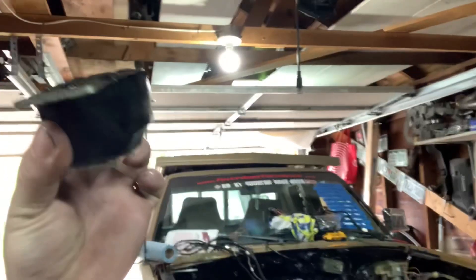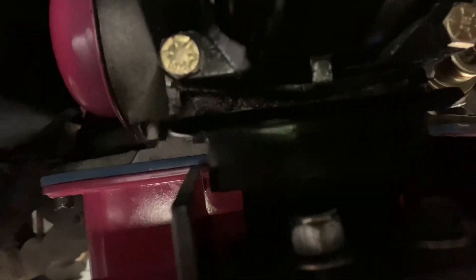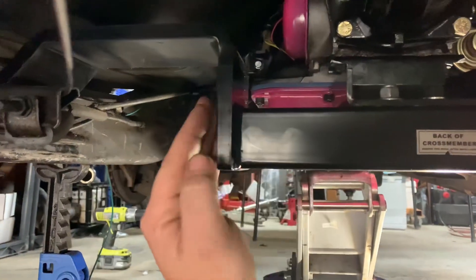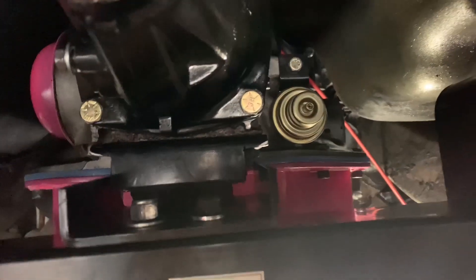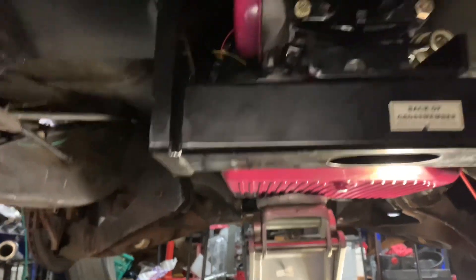But like I said, that thing is just really blown out and swollen — I don't really want to run that again. So we're going to try this next one. I'll get up under there and show you how it looks. This is how it looks on the TH350: got plenty of clearance with that G-Force crossmember, first-gen S10. It does have the notches out for exhaust if you're not doing a turbo system on either side — really nice little setup. It does fit well. I've got just couldn't reach some bolts right now, but I figured I'd get a video done for you. Tighten everything up — that is the final install of the transmission, minus the trans brake wiring and throwing on the shifter cable and adjusting it properly.